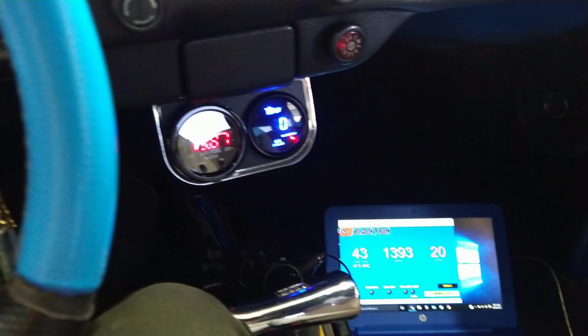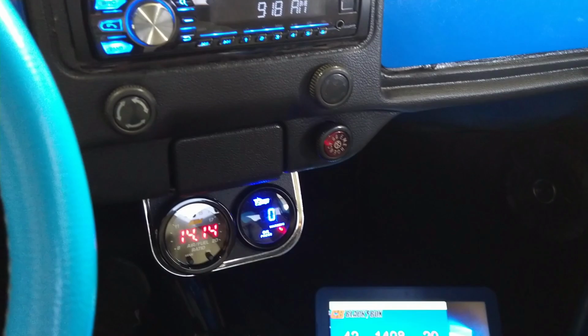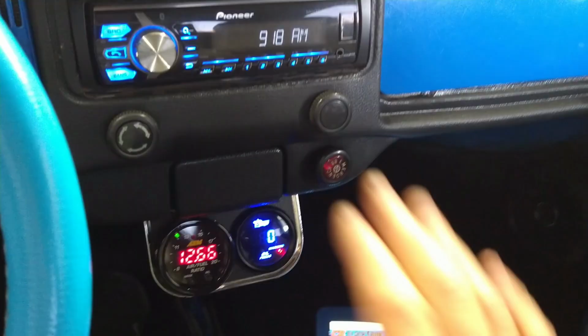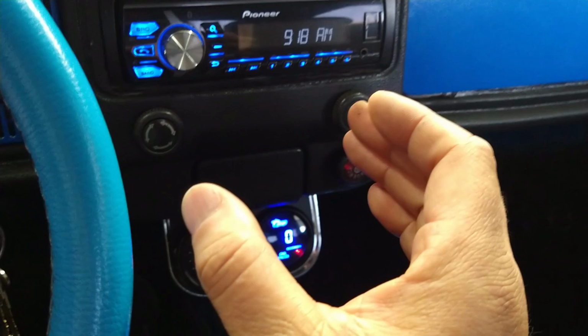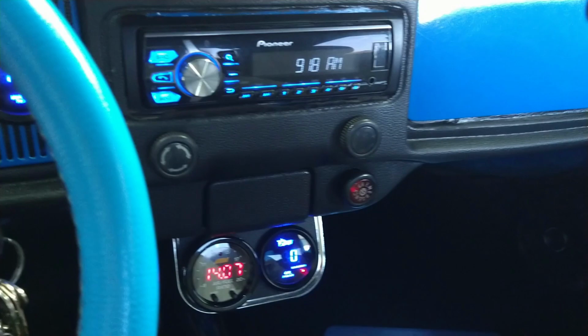And what I'm looking for is that when I step on the throttle, I want to hear if there's a choke, like a bleh, you know what I mean? And that's where you adjust the pump. Okay, there's a little bit, but I went like, boom, like a lot. That's normal. Remember, this is a center mount. It takes a while for fuel to get to the cylinders, to both sides. So you get that little bleh, but if you get like a whoop, okay, you need to add more pump on your little screw. You know, move it towards the negative side.